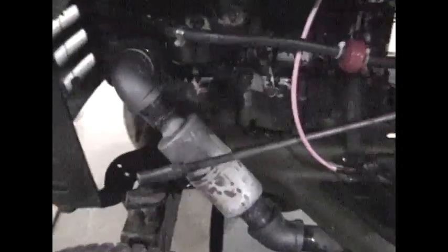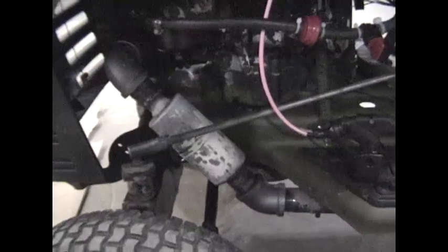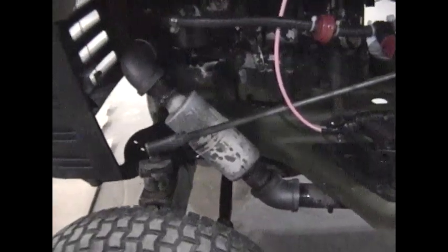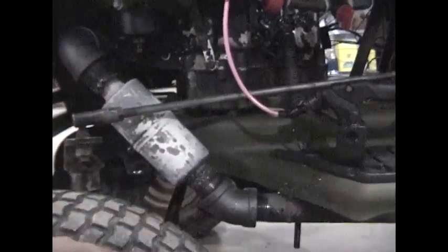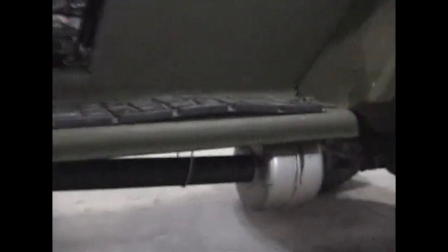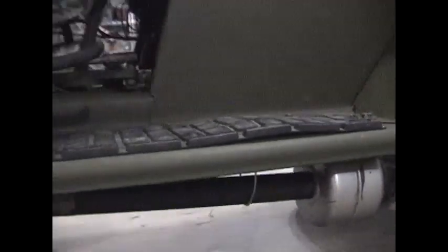Let me get closer to it and I'll show you exactly what I did. There's the exhaust coming out of the engine - I put a 90 degree tube in there. I welded a muffler, a front muffler in there, again with that Harbor Freight welder I picked up. Then I ran a pipe down underneath here and welded that there. I put another 45 degree fitting and ran a pipe along the back, and then I put a new stock muffler on it back there. So it has a front and rear muffler now.